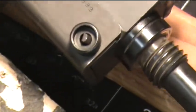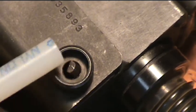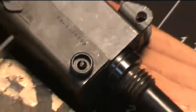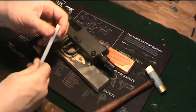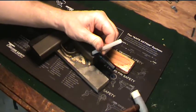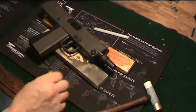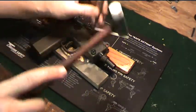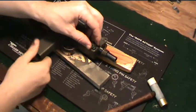In order to knock that pin out, you need to see what direction the pin is oriented and push it from the opposite direction. Easiest way I've found is to take a nylon punch, put it on at the angle you want, then give it one solid wrap with a nylon hammer. That'll push it through. An appropriate-sized drift punch also knocks it right out.